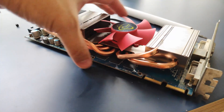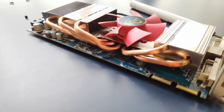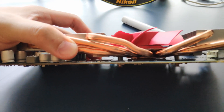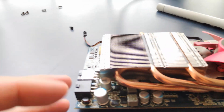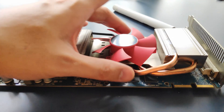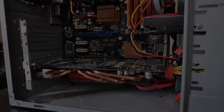Unfortunately, when installing this cooler I came across the problem of the heatsinks I wanted to use being just a little bit too tall to fit underneath, causing clearance issues. As a result, I've got nothing cooling the GDDR RAM. I'm going to record the temperatures and, if that doesn't work, I'll probably just transplant the fan onto the old cooler.